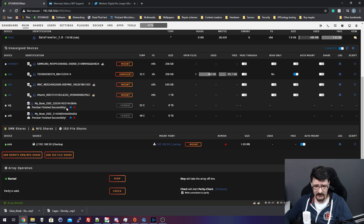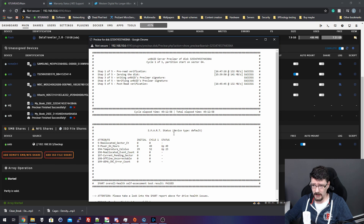With disc one now finished as well — also a success. Power-on hours: 49, so it took a bit longer than the second drive. Temperature not as high, but only by one degree. Now we can start the process of actually shucking these hard drives, get those sweet terabytes out, and prepare them for installation in our Unraid server. After shucking, I'll try one of these drives in the ICY Dock Black Vortex bay and see if it powers up and is recognized by the BIOS/UEFI firmware.